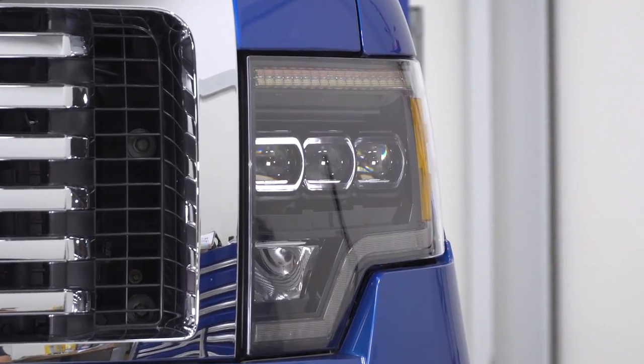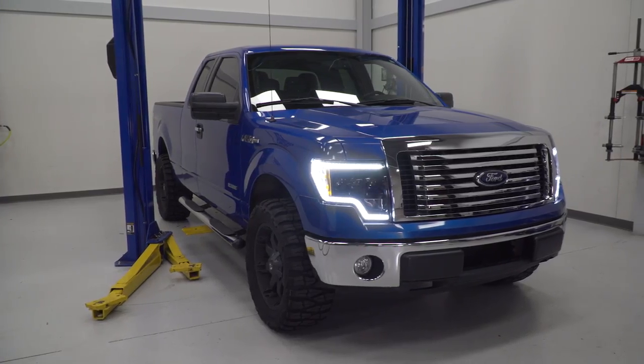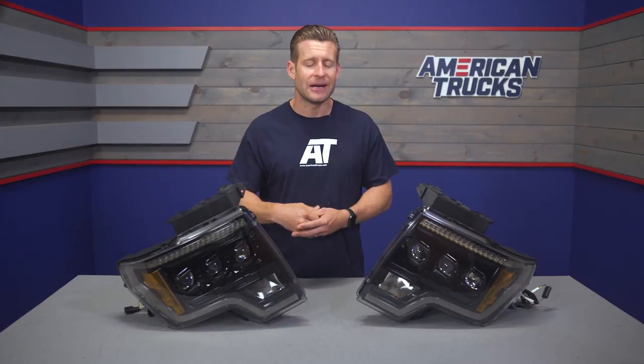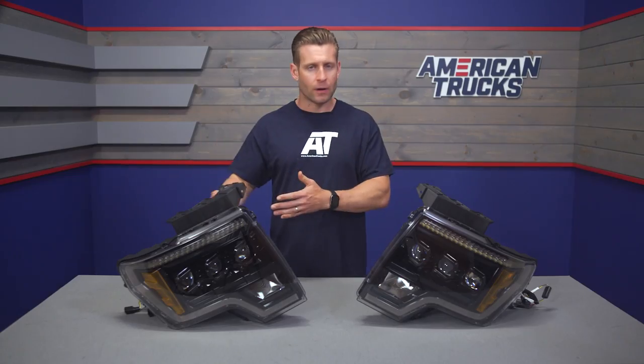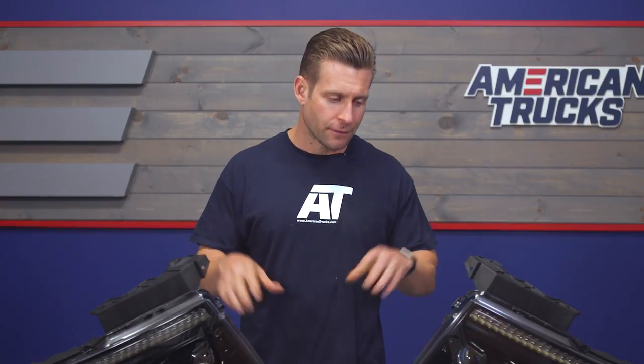This includes a piano black plastic housing with built-in aluminum heat sinks, topped off with an impact-proof polycarbonate lens. That lens has a UV coating baked in to help prevent any fading or yellowing over the years. Together, the housing and lens are sealed well enough to achieve a waterproof rating of IP67, which is something you don't always see in the world of headlights — that's just how well these things are sealed up.